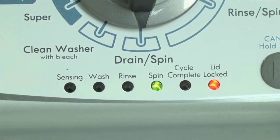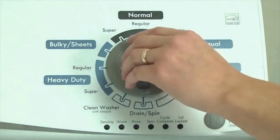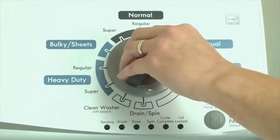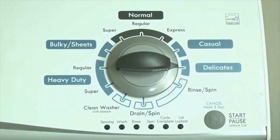Here's how to enter diagnostic mode to retrieve error codes on any brand of vertical modular washing machine. Step 1: With the washer shut off and all indicator lights off, turn the control dial 1 complete rotation — 360 degrees — counterclockwise, stopping with the dial pointing straight up. Now quickly, within about 6 seconds, turn the control dial 3 clicks clockwise, 1 click back, and 1 more click clockwise. Or, in other words, turn the control 3 clicks right, 1 click left, then 1 click right.